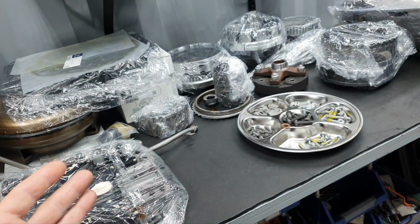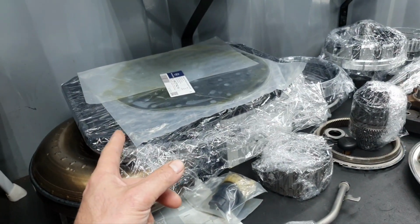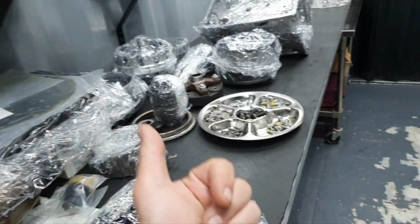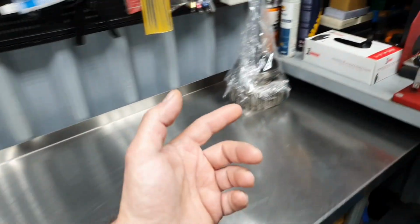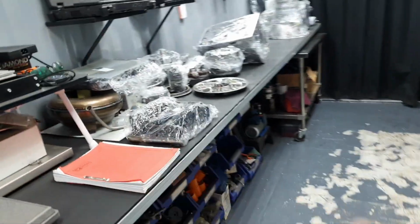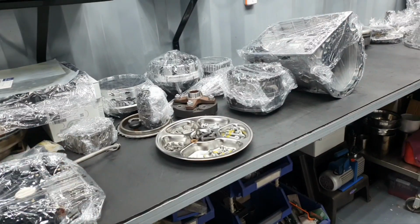What's remaining now? Three things actually. The drain plug for the transmission oil pan, which I haven't received yet. The bell housing that they haven't brought me yet. And the two clutches on the K2 drum here, which are missing two clutches. Then to check the clearance, put them inside, check the clearance and close it if I have the bell housing, which I haven't received yet.